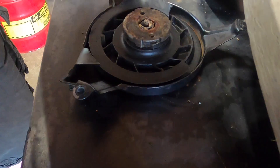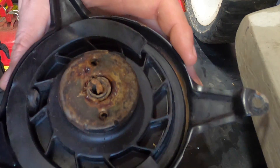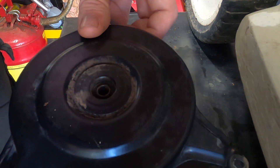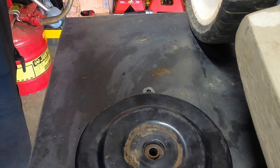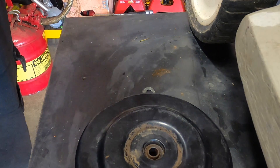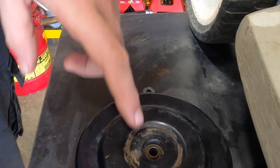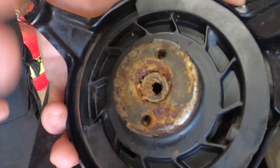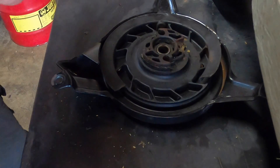What we are going to need to do is take off the top part and clean this out a little bit. The unfortunate part is we need to drive it out through there. If I was smart I'd have been soaking this a while ago to make it easier on myself, but I wasn't. I'm going to take a quarter-inch driver and kind of just pound it in there. You can sometimes take a screw or big bolt — it just needs to be exactly the same width as the little pin. You can see it's flared up there a little bit, and the whole thing just comes out. Okay, and there we have it — it's been taken apart.